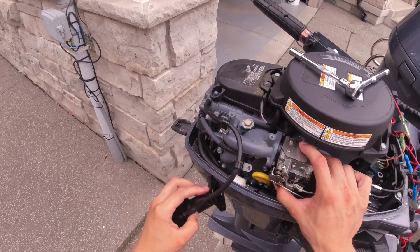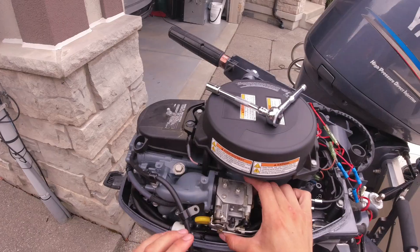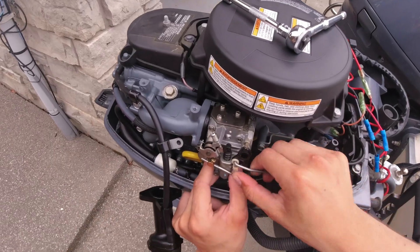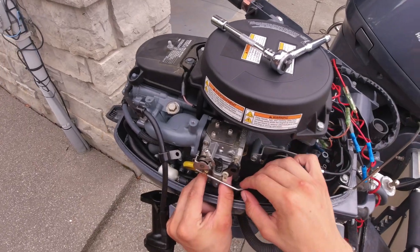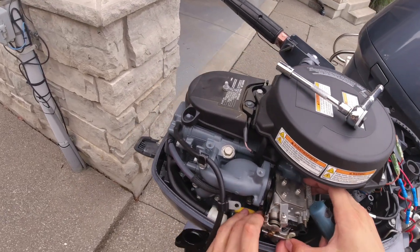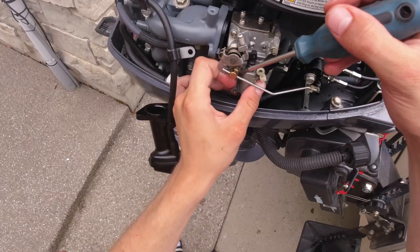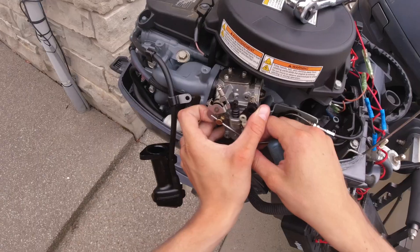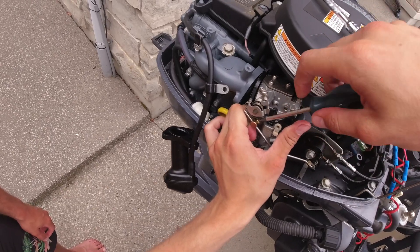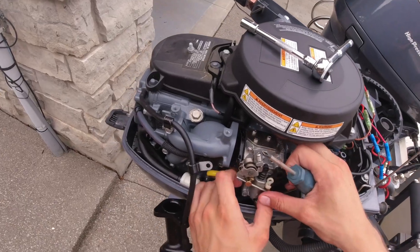Once the intake's out of the way, I checked that it was clear — nothing in it. Then I moved on to the choke rod. There's a little piece called the choke lever joint — unclip that and flip the choke rod back, really straightforward. There's also the throttle screw and the throttle spring. Do not touch that, or it will severely mess up your air-fuel mixture. There's a little brass Phillips head screw that pins the throttle rod to the assembly — just loosen it up and the carburetor will completely come loose once it can slide along that rod.